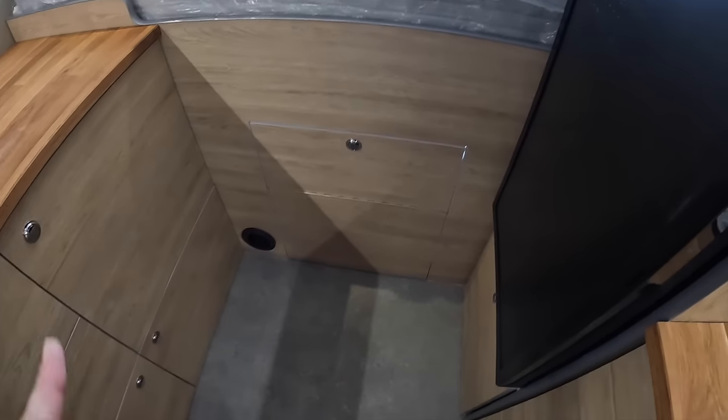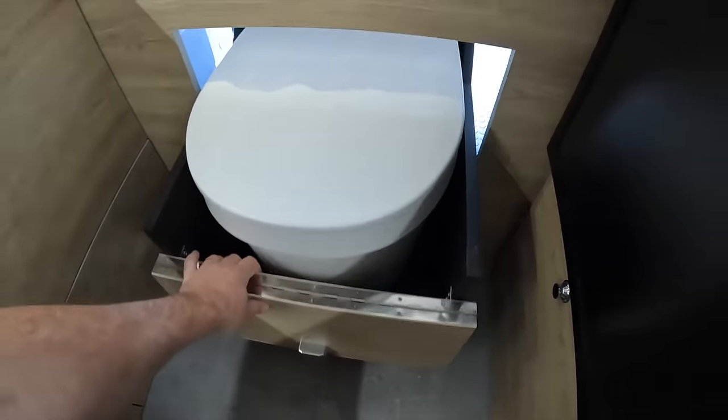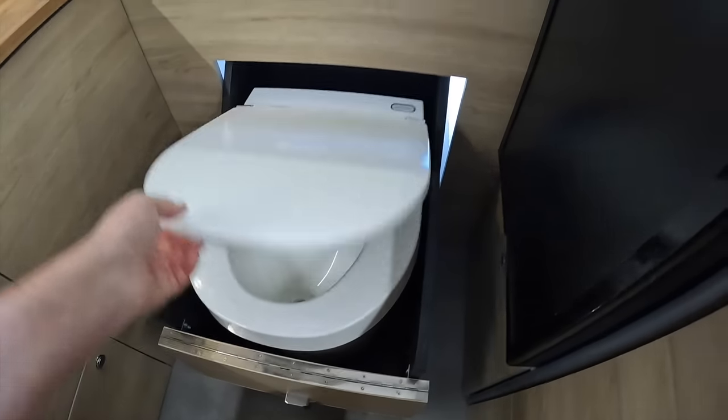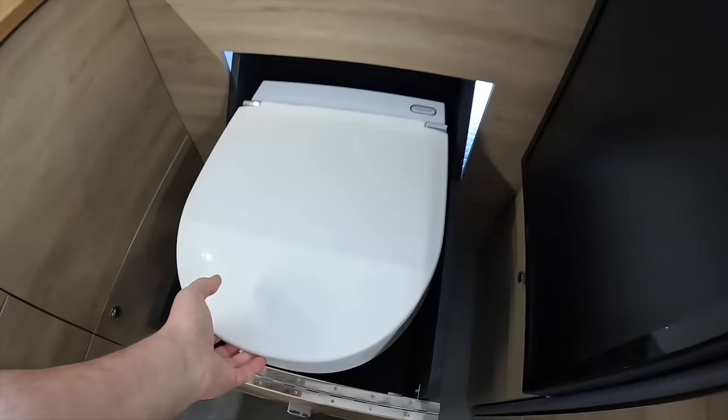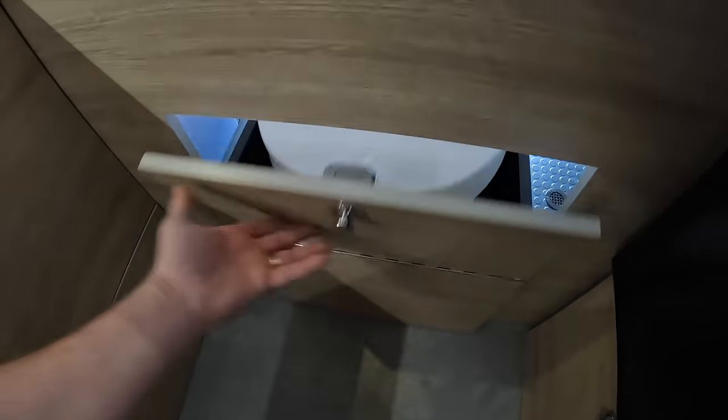And then this is a first for us, but we have managed to do a pull out slide out toilet, and he's opted for a separating toilet, and that tucks nicely into the garage. Now the runners for that can take up to 250 kilograms, so they're very heavy duty runners, but we've also angled it so that when the toilet comes out, on the bottom of that door, I've put a knock-on edge trim because it's nice and curved and it's soft, and we've managed to do that so that when it just gets to the end, that also sits on the floor, so that's now also going to give him long-term use on that.